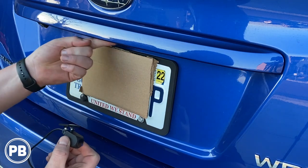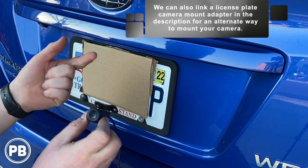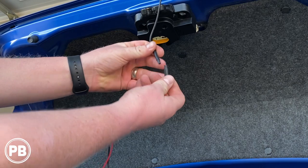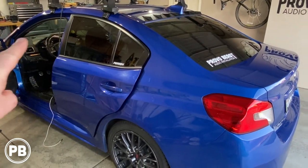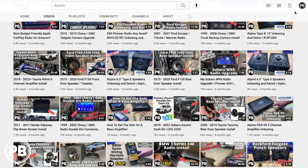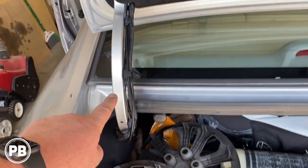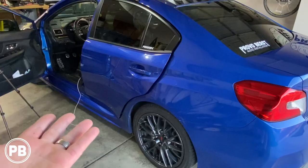We're going to go ahead and mount our camera here. We have a nice flat spot to mount this to. Our camera does come with a little double-sided tape mount, so if you don't want to put screws through, you don't have to — it's really strong tape, but we do suggest a secure mounting method so the camera doesn't fall off. Now a lot of you are probably asking how to run that camera wire really nice and clean all the way to the trunk area. We actually have a ton of videos on our channel for various backup camera installs on how to run all that cabling. If you have a SUV with a hatch you'll have to run it through the hatch boots; if you have a trunk you may need to run it through the trunk lid; or if your license plate is in the bumper it may have to go under the car.